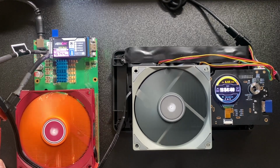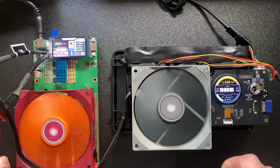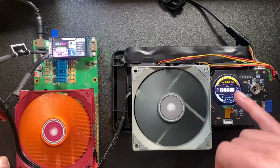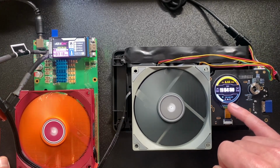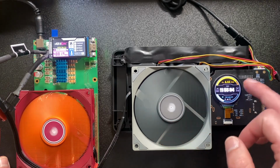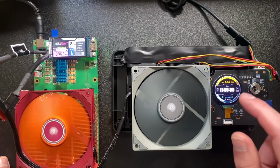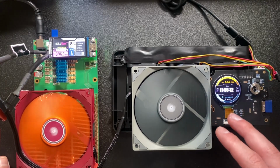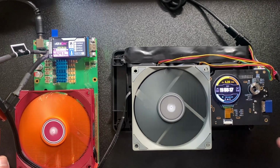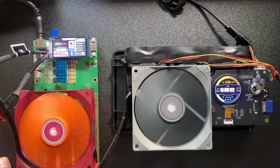It is going solely based off of the main purpose of the miner, which is the heating aspect of it. And anyone working at Avalon is saying definitely don't do this. I know it's displaying 6.44 at 58 watts there, but that is not a true figure. I had that yesterday as well, and that was an efficiency of around 12. So crazy efficiency, but I don't think that's the real-time hash rate. Yesterday it did display that number for about 30 minutes, but as you can see, it just went down to 4.26. So let's put that into a calculation.